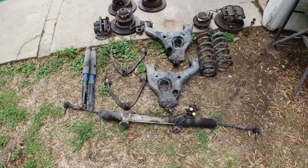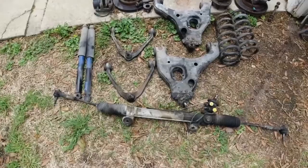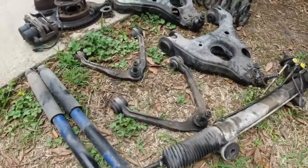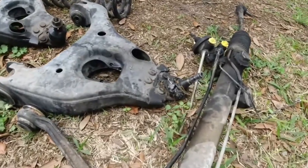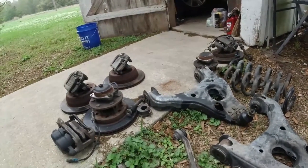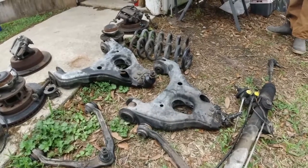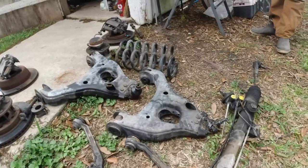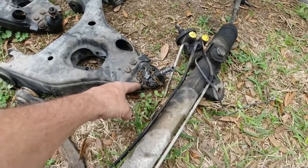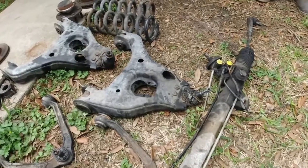All right, Outlaws, check it out, you big cam swappers. This is 200,000 miles worth of nastiness, right? Yeah, these parts look great under your car, but you know, trash. 200,000 miles worth of ball joints, bushings, tie rods, springs, brakes, rotors, all still good parts, nothing's failing. Probably had a good 50, maybe 60,000 miles in it if you drove with some sense. But this vehicle may take frequent trips to Mexico. And if we're gonna be going on short little quick trips to Mexico, I don't wanna do it with ball joints like that.